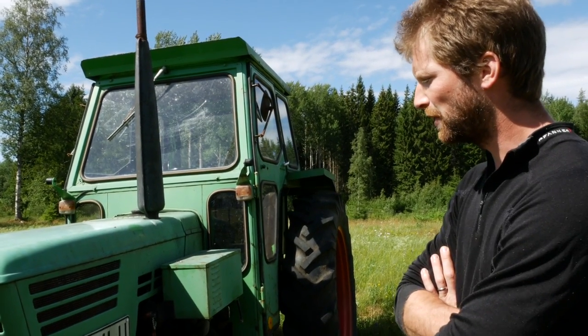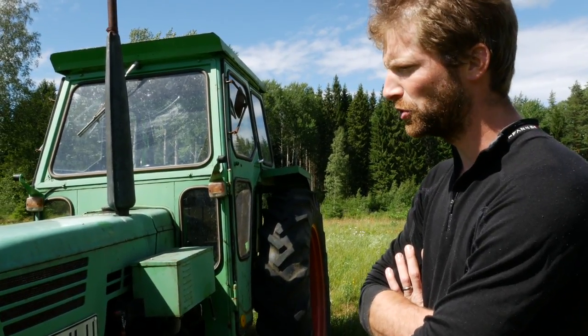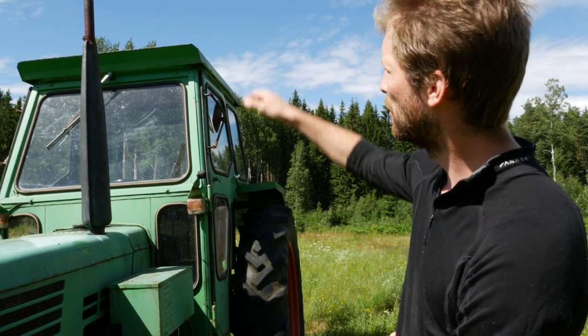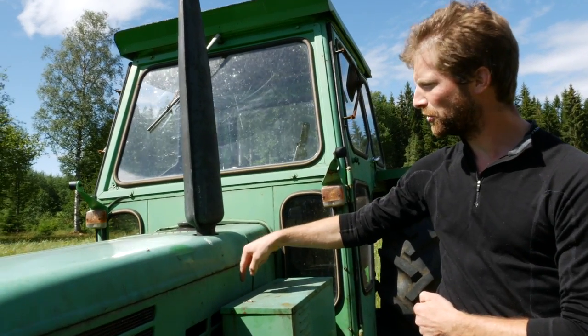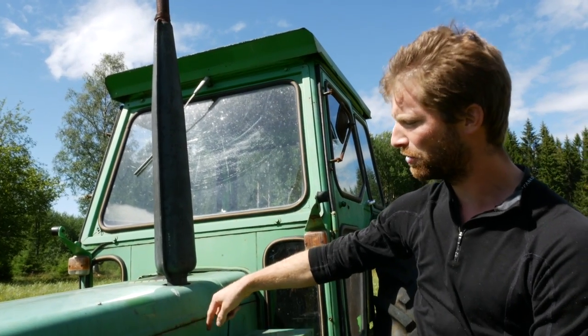Because it's been neglected, there are a few things I know need to be fixed and some things I just want to make sure are okay out of precaution since I don't have any history on it. What is broken on it is the exhaust manifold — it has a hole right where the exhaust pipe runs into it, because it sat outside and water must have run into it over the years and rusted a hole in it, so I have to replace that.